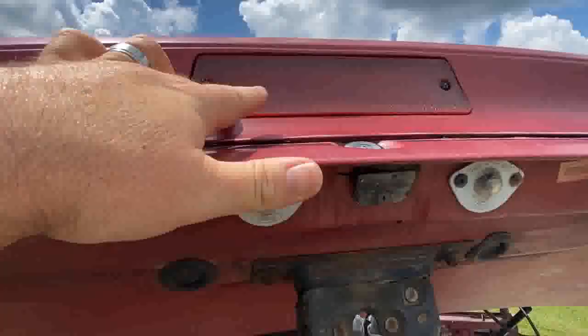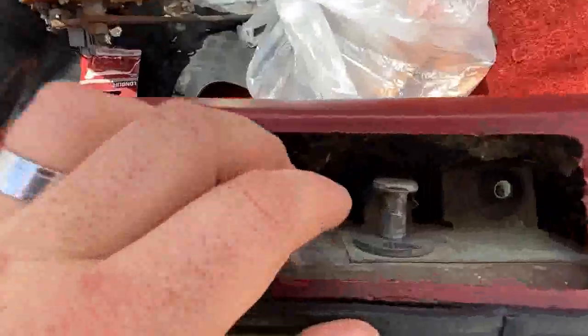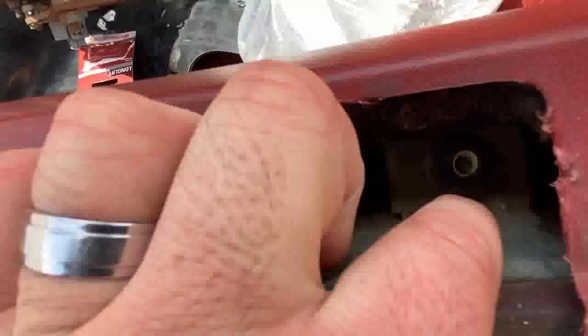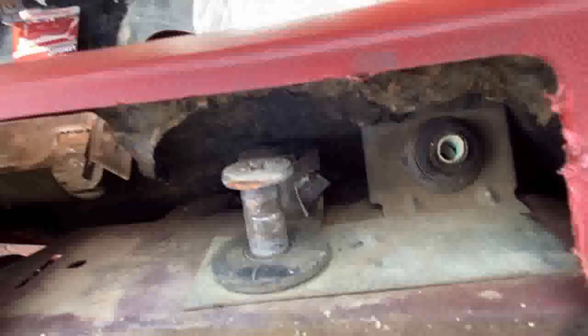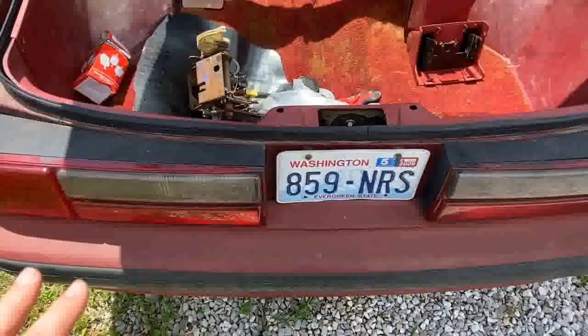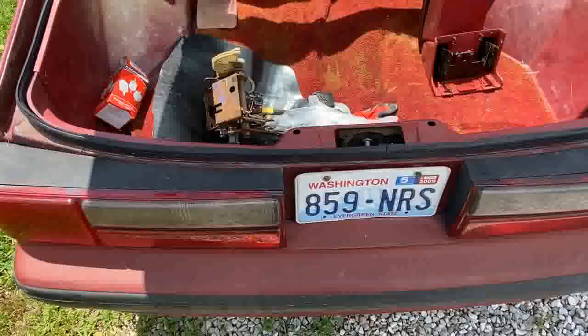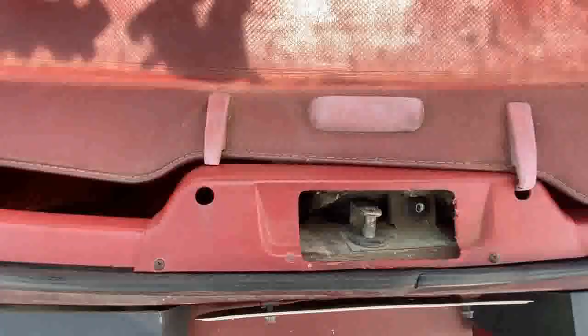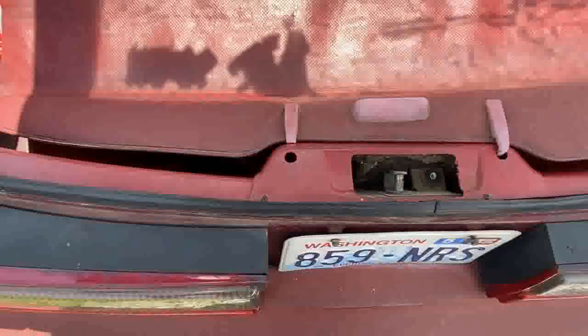New hatch weather stripping takes care of a problem I had. New license plate lights, new bulbs — the third brake light now works. I'm probably going to have to get a new striker because there's supposed to be a plastic case on it, and a new plunger for the hatch light system. I need to see if I can get the hatch light to work. Those are minor details but I want to get them sorted while things are apart. I did manage to get the hatch cover assembly hooked back up properly, though I may have to find a replacement or just replace the whole thing.